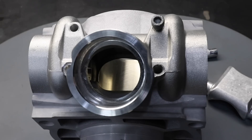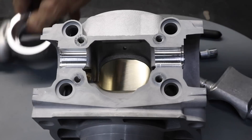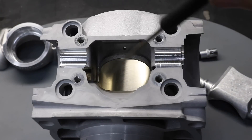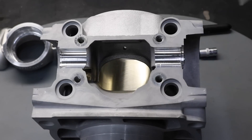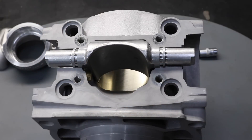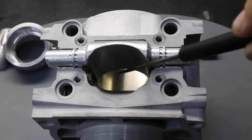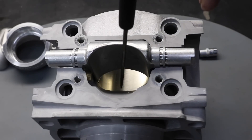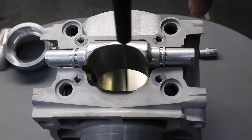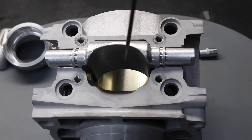To better explain that, here I have a 300 cylinder, and the exhaust valve is located behind this cover. If I take the cover off, you can see the exhaust port here, and the exhaust valve fits into the cylinder like this. Right now the exhaust valve is closed, so it will be closed at low RPM, resulting in a smaller exhaust port with a low exhaust port height.